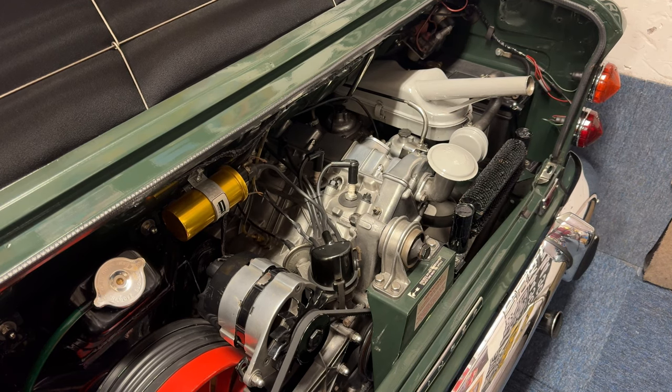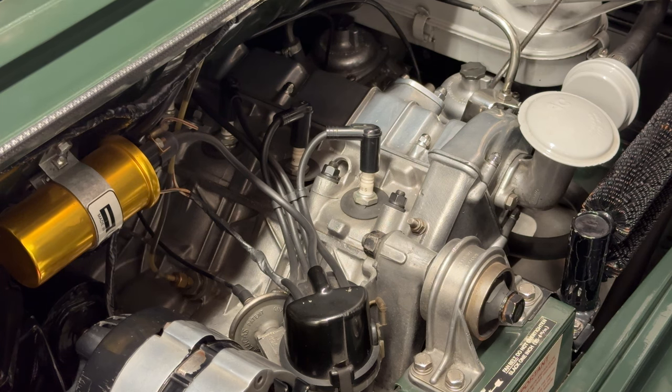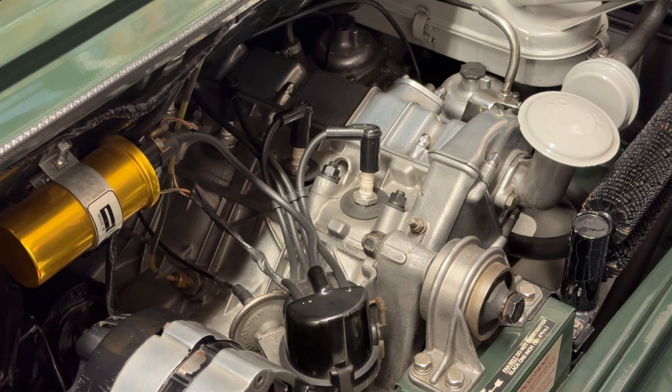They're a great car — a few people have issues with them but I've never had any. That's a dashpot with a piston in the top. A lot of cars had SUs on, which were a similar design carburettor — these have a rubber diaphragm whereas SUs have a piston and a spring. You should always check the oil in them because they do use a bit. There's special carburettor oil for the dashpots, but you can use ATF fluid — it's just a little bit thinner, which helps when revving.